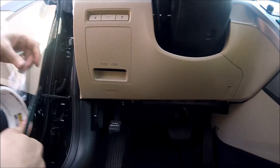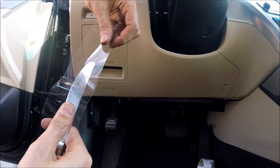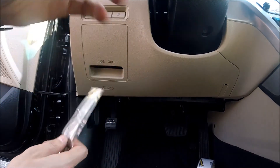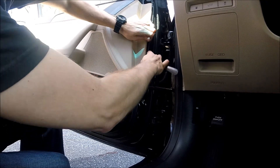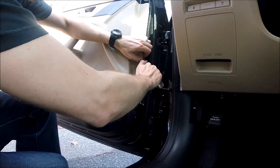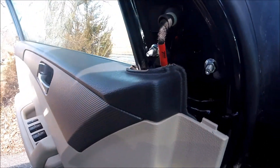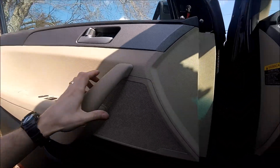I got a knife and I'm gonna put some tape over it so I don't scratch my panel. What we're gonna do — I got one clip out already — and what you want to do now is unclick your clips, because here you have clips like this. See this pink clip? It holds the panel on the door. Same thing goes in here, and further you get more and more of them — they are all around the perimeter. So I'm gonna try to unclip them now.